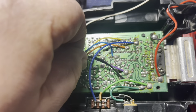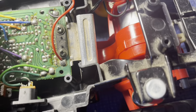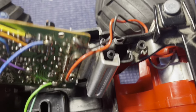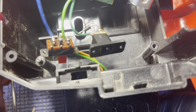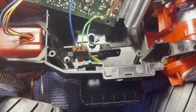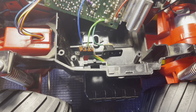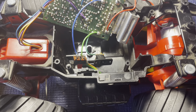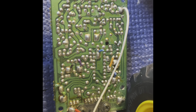I'll cut these wires and get them out of there — there are your switch wires, and then there are two wires that go from the switch down to the batteries. We're going to wire the Hobbywing battery plug to those. Running double-As on this — using rechargeable double-As they're 1.2 instead of 1.5 volts — it'll end up being around 8.4 volts, like running a seven-cell nickel-metal pack. Should work pretty well.